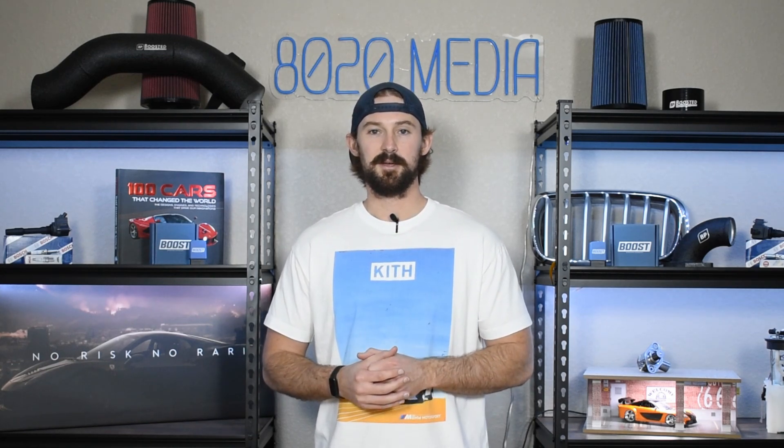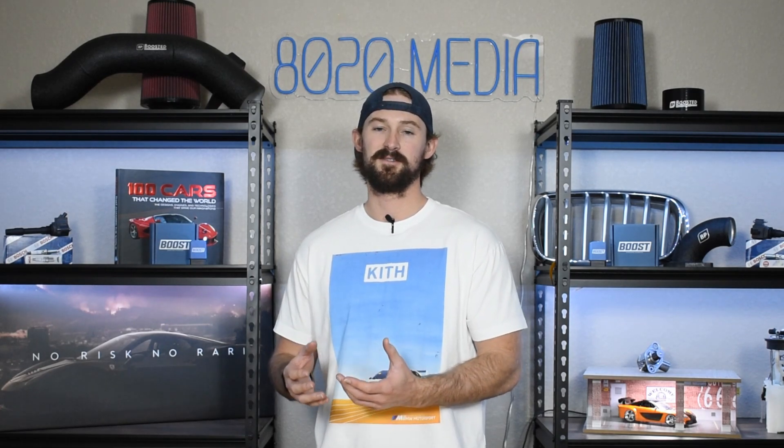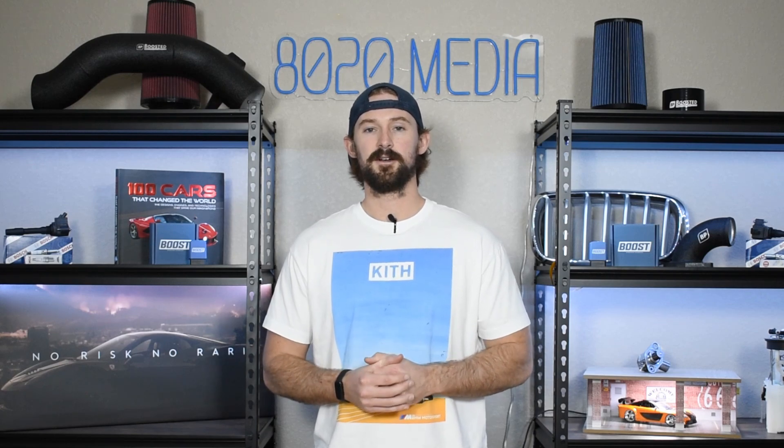With that being said, tuning, an intake or drop-in filter, and an exhaust system can add a pretty good 50 to 80 horsepower to these engines at a relatively cost-effective price — that would be my recommendation of where to start. If you're looking for more, stay tuned to our channel as we'll do more videos on the 5.4 Triton. That's all we've got for this one, so if you appreciate the content please click the like button and subscribe for all the future content we have coming.